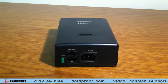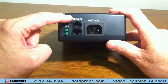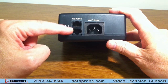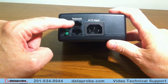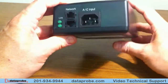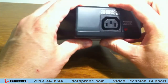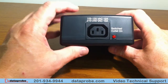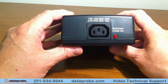This is the iBoot original. This is version 3.0. The network jacks are auto cable speed detection and direction, so it doesn't matter if you have a crossover cable or a straight cable. They are wired the same and it forms a mini hub. The AC input power is also wide range input, and you no longer have a selector switch on the side to select the input power, as it will automatically detect the input voltage range — 105 to 125 volts AC or 210 to 240 volts AC.